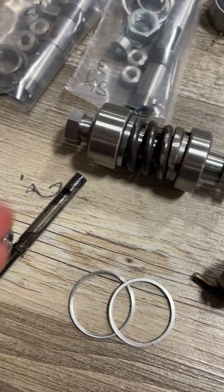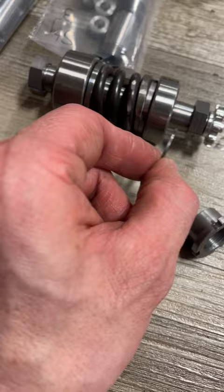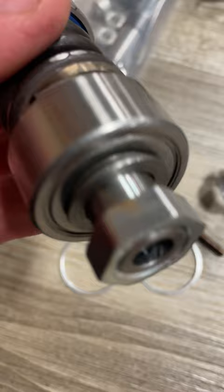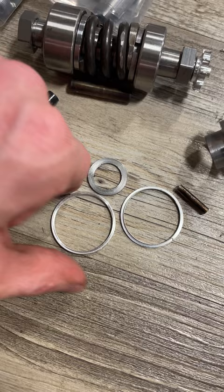Neither of those situations is good, and you correct that with these shims — they can go on either bearing, whatever makes the gear line up nicely. There's also a shim that can go underneath the drive sprocket, which goes on this side. These aren't always required but they're helpful and always included. We also have three spacers because this side is an extra five millimeters out, so you need to space out the sprocket cover by the same amount.